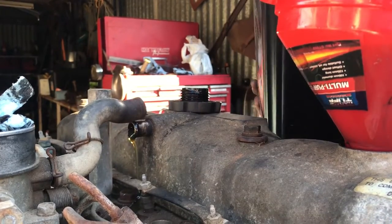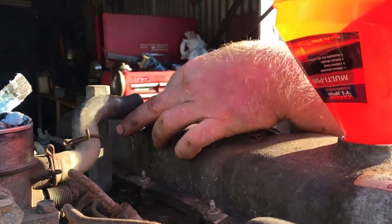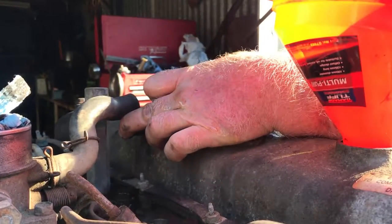There we go and you can see the oil coming out there. That's going to end up in the intake manifold and it's eventually going to hydrolock a cylinder, so when you're filling a 2H just take your time with it.